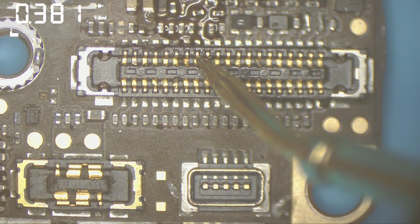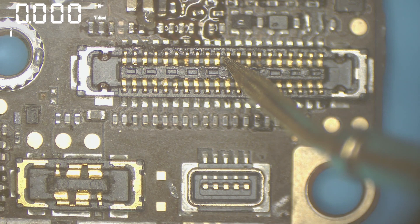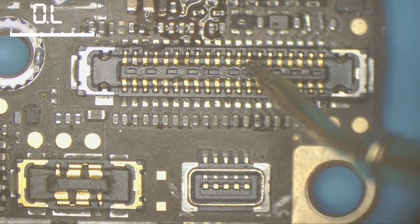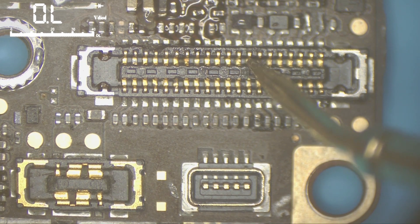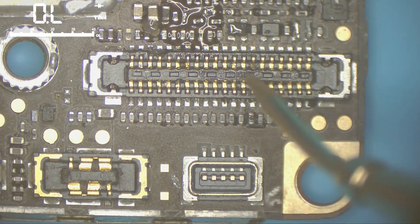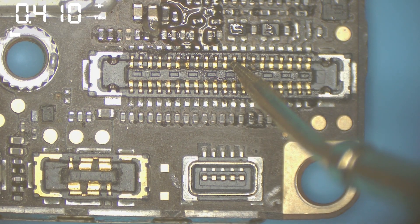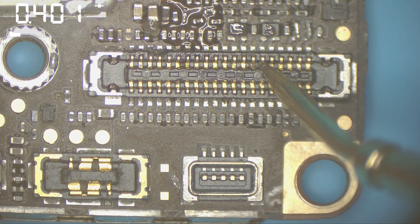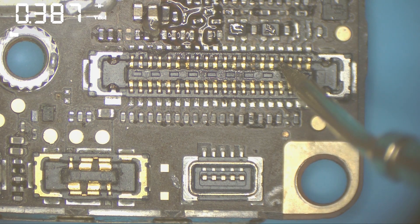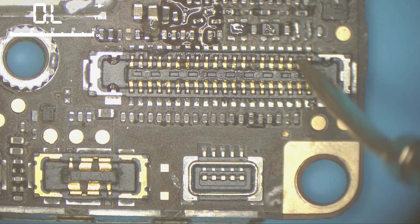The rest of the connector reads around 380–400 ohms, then ground — that's fine. The next group of pins is connected to coils. If two pins connected to the same coil give different resistance values, the coil needs to be replaced or jumperd. I measure: 400 and 400 — fine. Then ground. Then again 400 and 400 — but the next pair is different from each other, so that coil needs to be replaced.